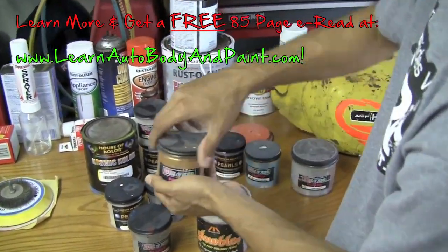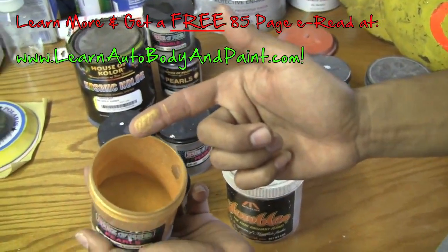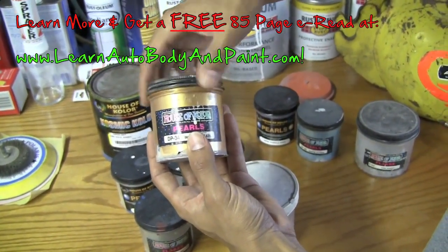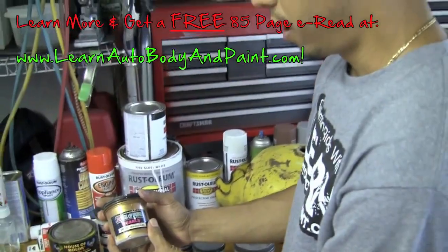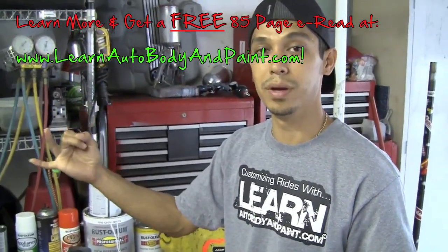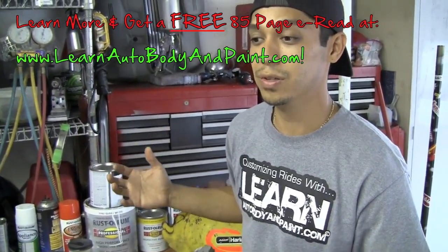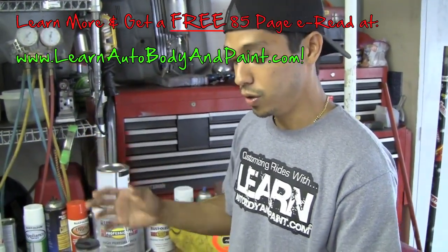Here's what a gold pearl looks like — pretty cool stuff. You can put this over a black base coat or a silver and you'll have a pearly effect on your paint job. It's about 30 to 40 bucks per bottle and you could probably paint 20 cars with this. With every base coat — whether white, silver, red, or black — putting this gold pearl over it gives you a different effect across each paint panel. So it's good to do a test panel to see if you're going to like it on your car.